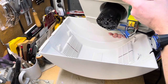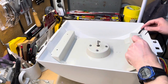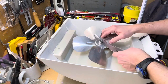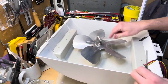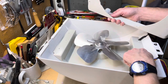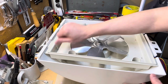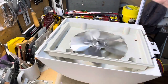Once you have everything connected up here, carefully lay this down right inside. Make sure that the wires are positioned in their channels. Line up the flat side of the motor and attach your fan blade — be careful not to bend your fan blades. This should spin freely. These little notches and bumps will hold the shroud exactly where it's supposed to go. Now take the four screws and put this back together. Check your fan spin.